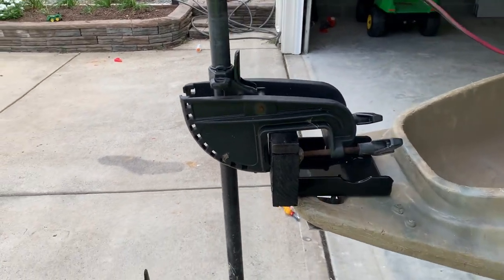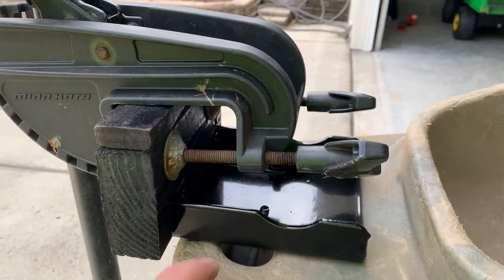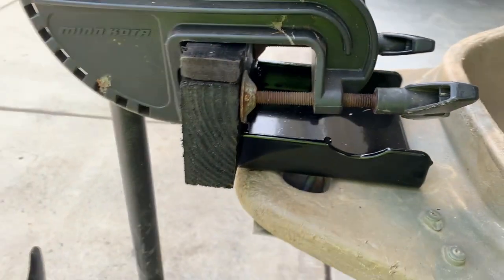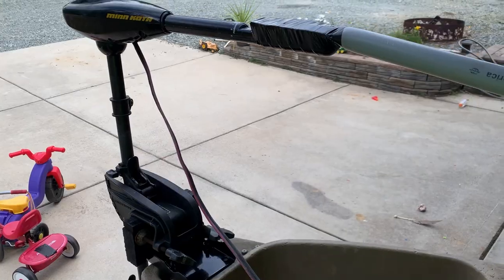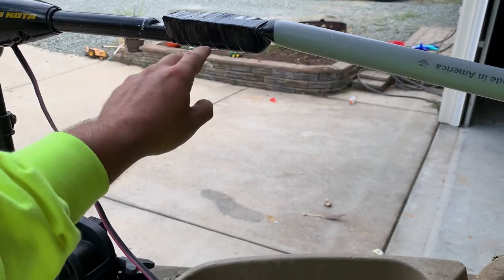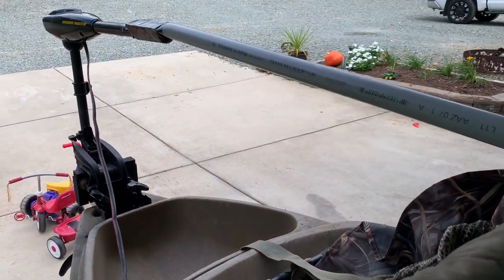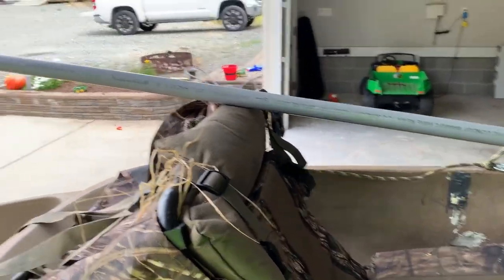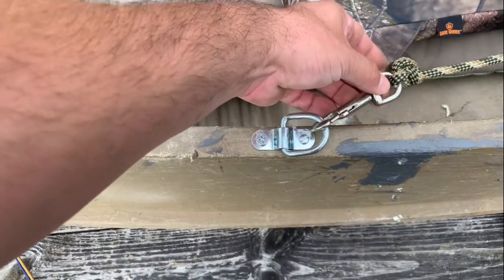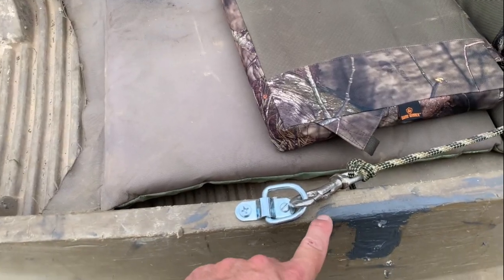Round three — I think we may finally have it. We got a nice secure bracket on here, just some miscellaneous parts from the garage. This base bracket actually came off a spare tire holder, and then I married it up with some L brackets to a vertical two-by-four. Gave an extra little bit of lift just so the wings would clear, but it is really strong and really secure. Try not to laugh too hard, but the problem was where I'm going to be sitting way forward towards the middle of the boat — I couldn't reach the handle. So I actually heated up a piece of conduit, flattened it out, and electrical taped it to the handle. It's very easily turned from the front. If it works, I'll come up with something more permanent and paint it to match. I'd like to make this removable, so it's not such a long apparatus. I went ahead and added some clips so I can easily pop it off if I want to take the whole assembly out really quickly without untying any knots. Little changes when you get on the water can make a big difference.